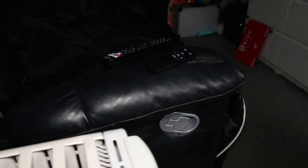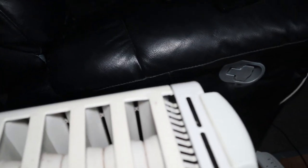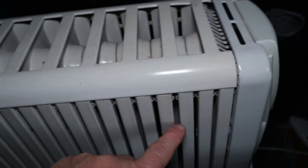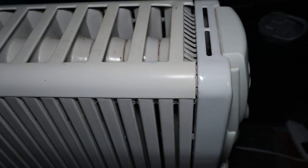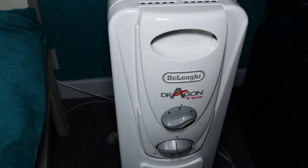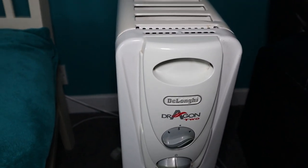On the DeLonghi we've got eight fins, but they spread out and curve around, then there's an external piece — much more total surface area. All that extra surface area is heating the room more efficiently. It's a few years old, a bit dirty and rusty, but still performing well. So the Shallon is not quite as efficient — it's consuming half a kilowatt more but producing slightly less heat — because it hasn't got as much surface area on the fins. Worth remembering when looking for one.